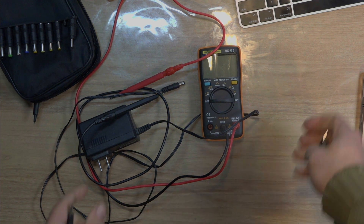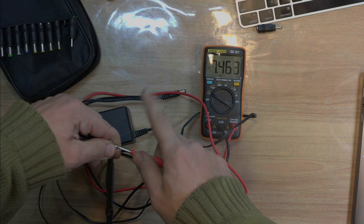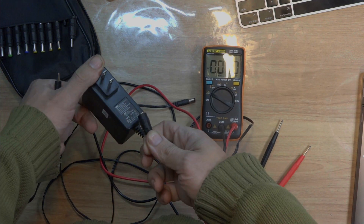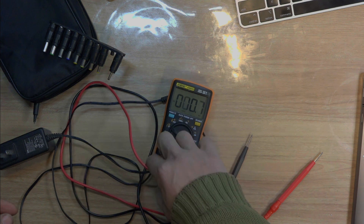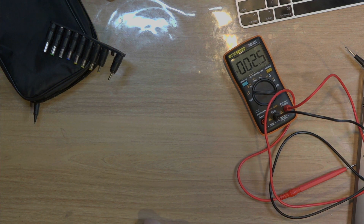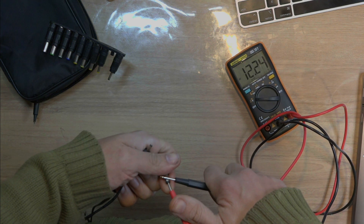Not every laptop is going to be like that. You put the probe here and the other one here. As you can see, we have a seven — but we should have a 12. That is why I took one of these regular chargers, bought one of these adapters, and plugged it in. That is the easiest way to test if the charger works or not. With the other one, we have 12 volts — and there we go, we have 12 volts here.